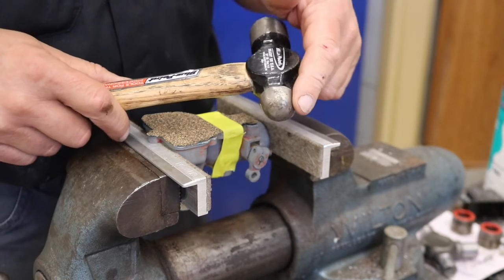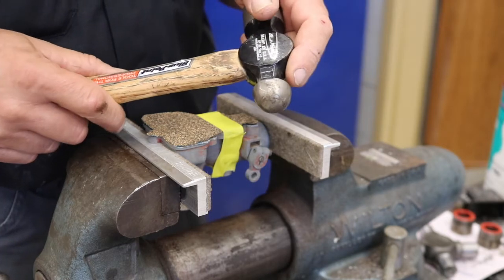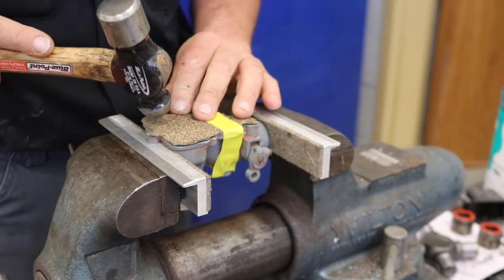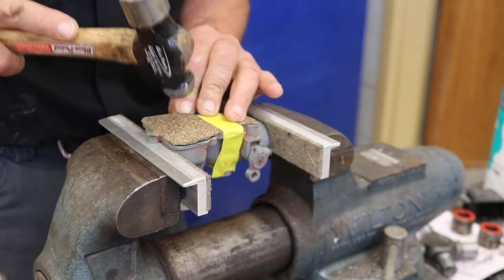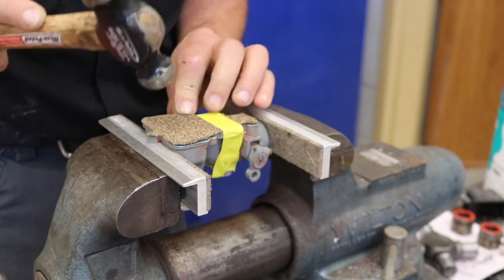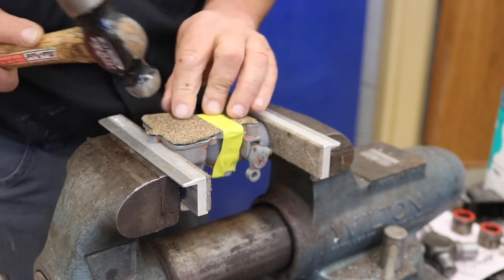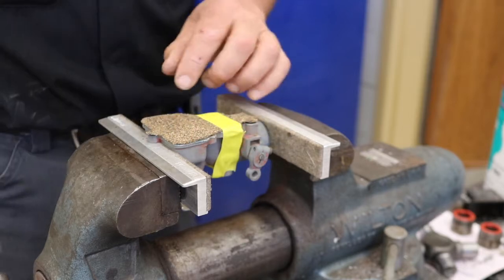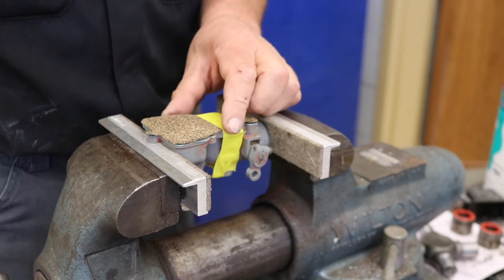Now we're going to use this end of the hammer, the ball end, to make the gasket, that's actually what it was designed for. And again, you've seen me and the students do this in previous episodes. So, but now I'm going to be even more gentle. And what I'm cutting out here is the bowl area for the carburetor. I do need to keep lifting periodically. So we're going to keep doing this around the entire perimeter until we get that center out, and then we can start working on some of the smaller pieces.